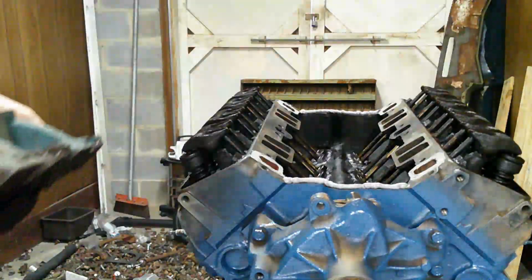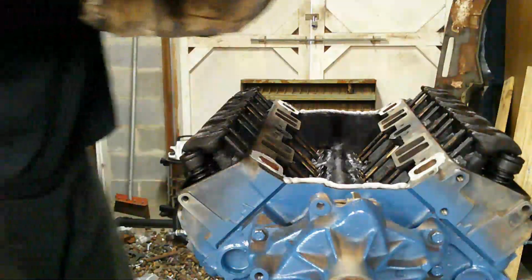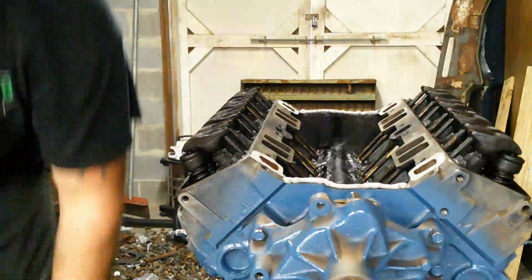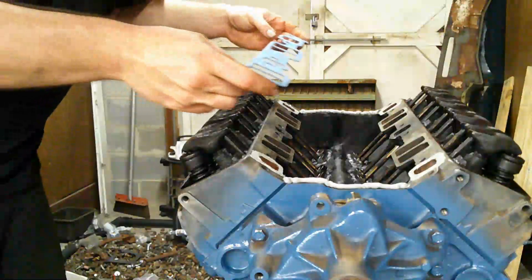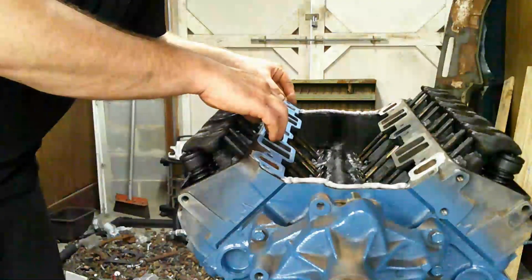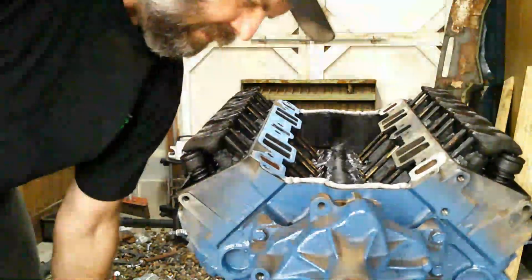There are differences in silicone, don't get me wrong, but all I know is you use, oh crap, probably help if I put the intake gaskets on before the intake. Like ultra copper and the red hot stuff, that's for exhaust, like exhaust header flanges or stuff like that. You wouldn't want to use black or gray on something like that.